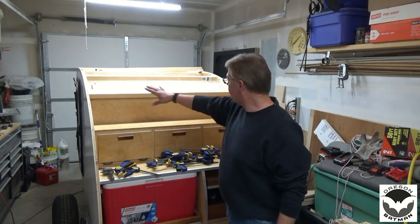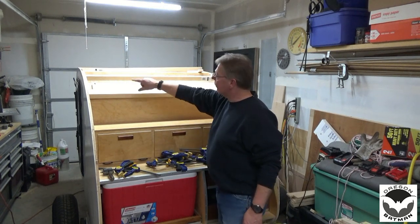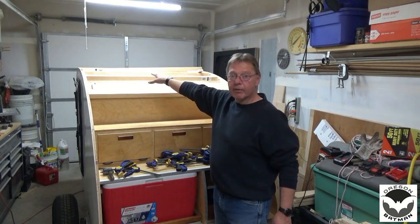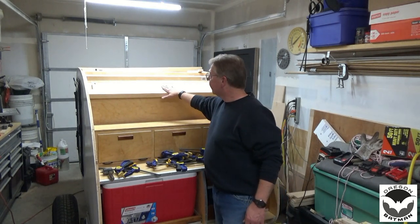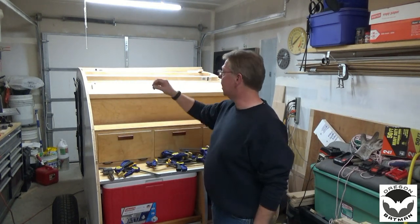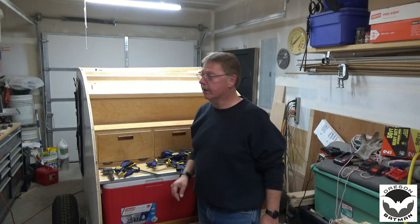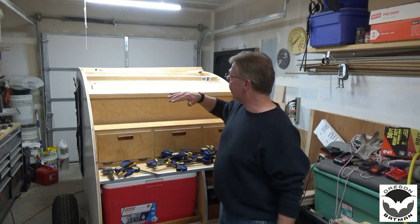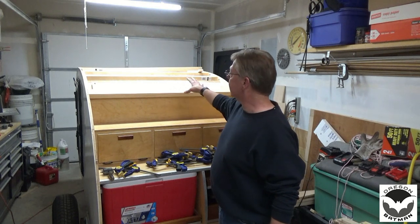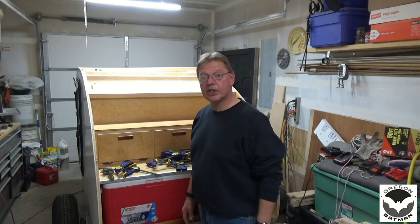Okay, so we've got the back installed, we've got double spars here on the back, we've got our spacer set, and we're about third to fourth spar in. So, everything's working fine, contact cement, pushing the ceiling up, made good contact, we'll run a bead of 5200 across that, that isn't going to go anywhere. So, at this point, I'm going to go ahead and finish the rest of this, same way that you saw me do these. And then when we're done, I'll give you a shot.